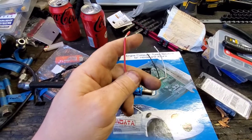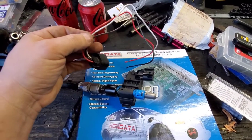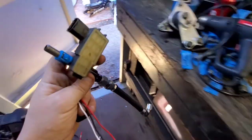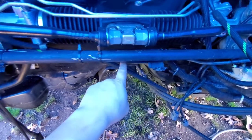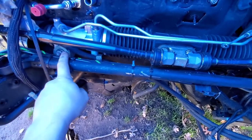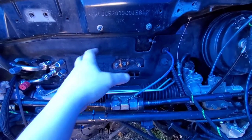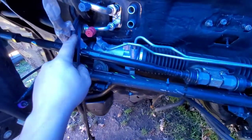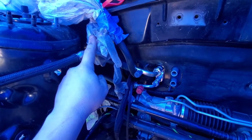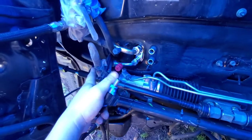You want the sensor powered when the car turns on — so you want it to turn on as the ignition turns on. My return line runs right here; I'll zip tie that there and run it along the lower part by the rack and pinion. I moved it down lower because the turbo manifold is going to come out right here and I want it to be as far away from the heat as possible. The flex fuel sensor will hook up in between the return line and the fuel pressure regulator.